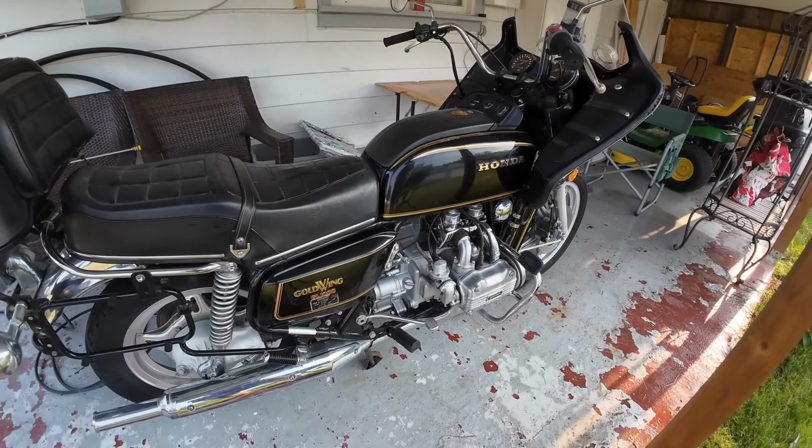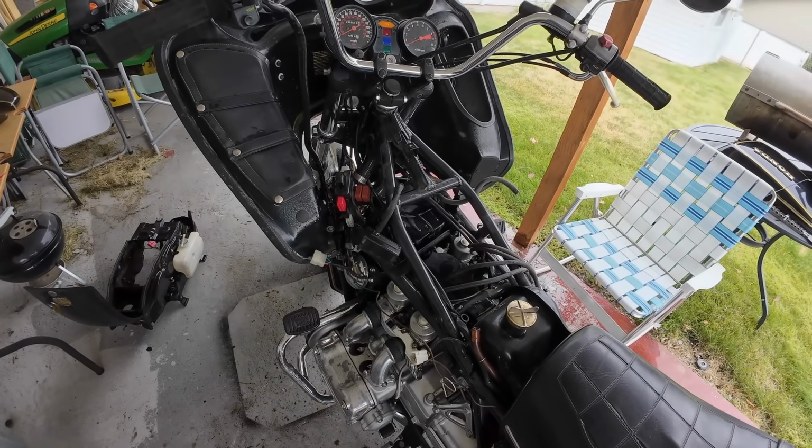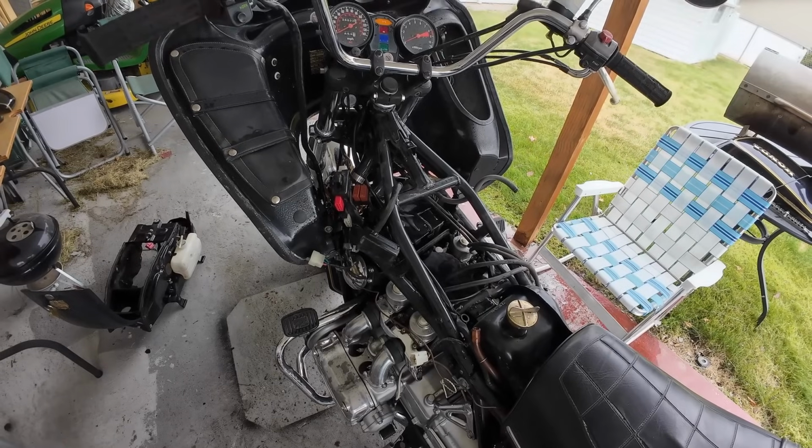That's good. Well, I was able to determine that only 1 cylinder was running when I brought it home yesterday. It was 1 out of 4. That's not good. So I just tested the coils and the high tension wires that go down to the spark plugs and the ballast resistor and things like that. They're all good. So I still don't know what's bad, unless the coils aren't getting 12 volts. But I'm just checking one thing at a time. This is a wintertime project, and this is still July.